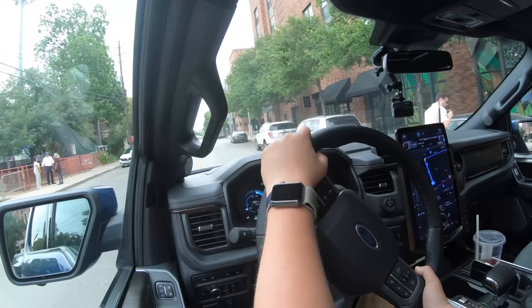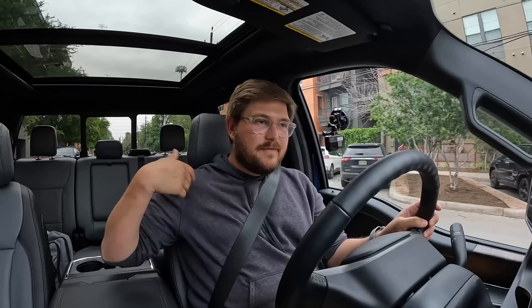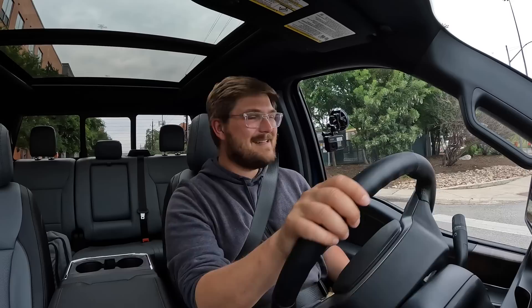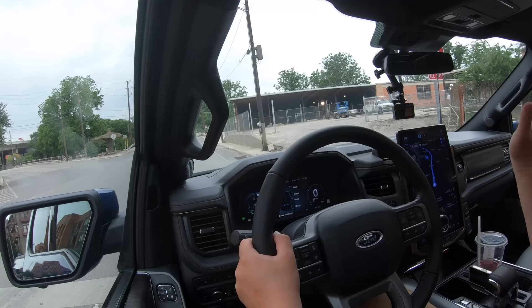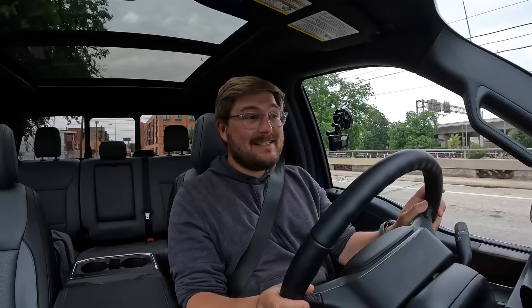What I mean is it does everything the motors can do and then we're rolling backwards before it clamps down on the friction brake — that is not good tuning right off the bat. Perhaps it would be nicer to drive without one pedal drive mode. Coming to a stop we're coasting, then it grabs friction brakes — it should just do that at zero. Steering ratio is a pretty slow rack, which I like — very truck-like. You can put in a lot of steering input without crazy wheel movement, the opposite of a Model 3, which is kind of what you want in a truck.